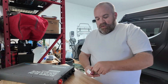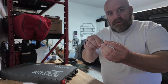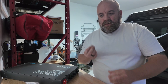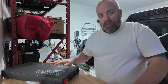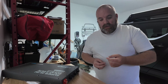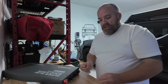The crazy part was I had to go to O'Reilly's because Best Buy didn't have these. The only reason this is safe for this application is that it's 5/16th ring terminals, whereas Home Depot only carries 1/4 inch. The 5/16th is more meant for outdoors — boats and stuff like that — and it fits perfectly over here.